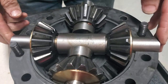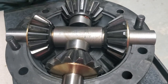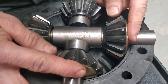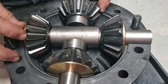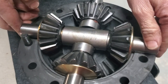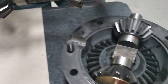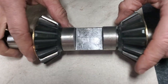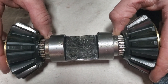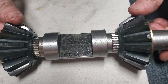We've got custom billet cross shafts — these are stock IH spider gears. You can see they add these brass thrust washers on the side, and that helps to reduce friction on those spider gears. I'll pull one of these crosses off of here carefully, because I really don't want to play 52 pick-up this afternoon. I'll just spread these out a little bit, and there you go — you can see the needle bearings underneath the spider gears.